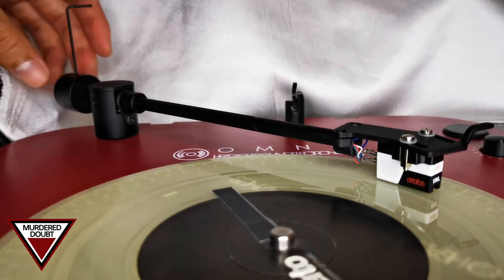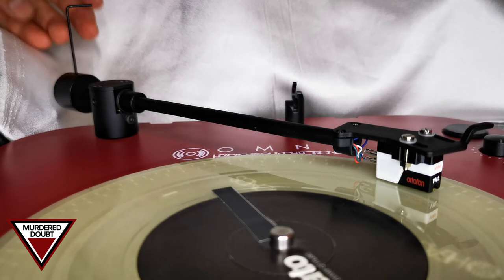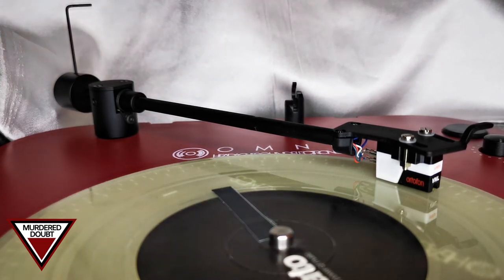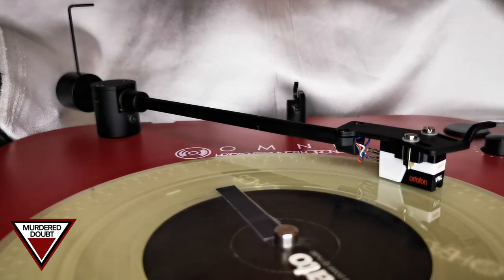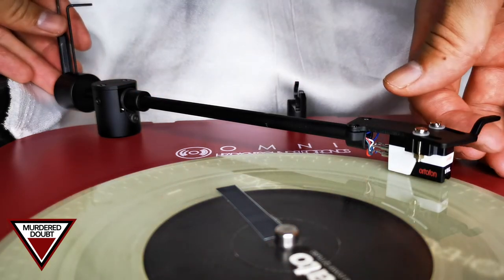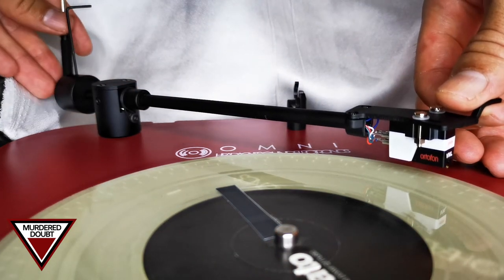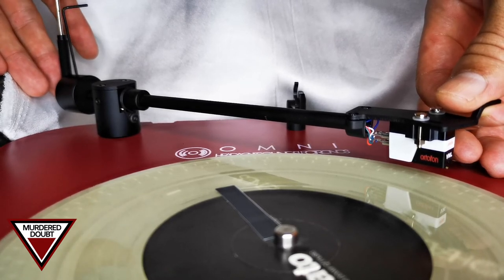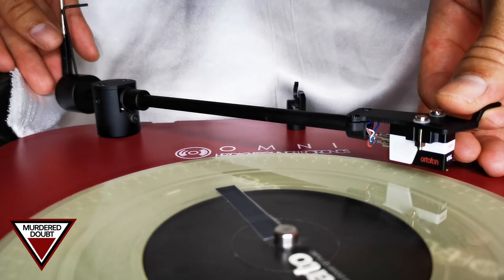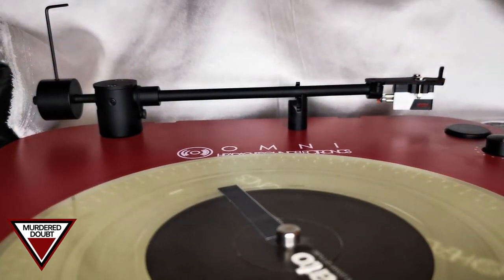Because these are new, all I can do is just find a random setting. But what you can do for yourself is tinker around. There is no perfect setting because it depends on your hands, how you handle the vinyl, the type of needle, type of turntable, type of tonearm. Make sure that your turntable is level on the floor, just to make sure that your needle sticks. I know there's a bunch of things that you can do to balance things out, but what you saw me trying to do is find a measuring tool so that I can always keep that counterweight at the same place.